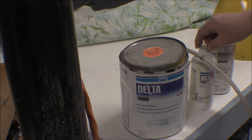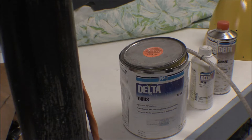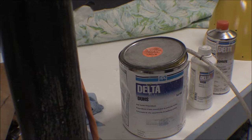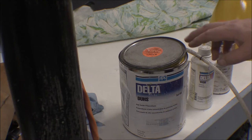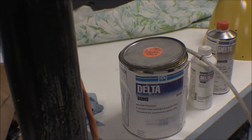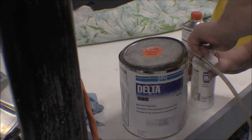I'll do the same thing for both the hardener and the accelerator, and those are really critical because they use the moisture in the air to activate. Before I did this, once you open a can of hardener or accelerator, you had a short period — a few days — before it'd start gelling up to the point where you couldn't use it. Once I started putting the CO2 in there, that stuff has lasted. I've had this paint and this stuff for about four years, opened and used a couple of times.